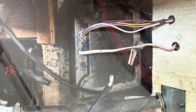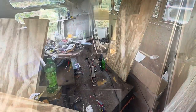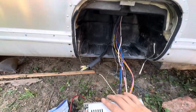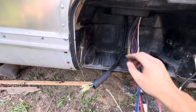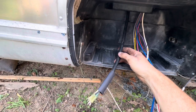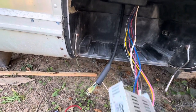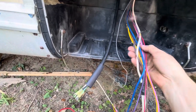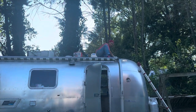It's time to work on the power box. All of these components were underneath the stove on the inside of the camper - this is where the battery used to live. I've taken the battery out. This line comes from the shore connection, which is just going to be your average 20 amp plug instead of the big 30 amp plug this was originally wired for. That's going to be powering this converter - it'll step down our AC to DC 12 volt - and that will power the DC fuse block. All of these are the main runs for the camper and they'll be plugged into that, making it super accessible to the owners.